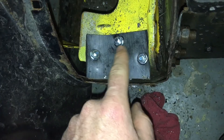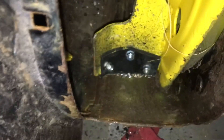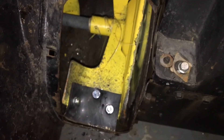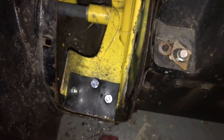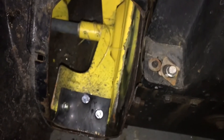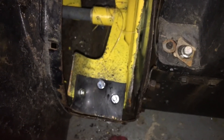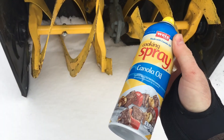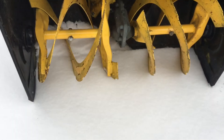I've got all my paddles installed — three bolts, three nuts, and three washers — and it turns over but it's pretty tight. So I'm going to put the chute back on and then spray some proprietary snowblower impeller lubricant inside the impeller housing to help the paddles bed in, and start it up and let it run for about five minutes. The lubricant I'm going to use is just plain old cooking spray — I'm a little skeptical, but it was my neighbor's advice and he's from upstate New York so he should know.